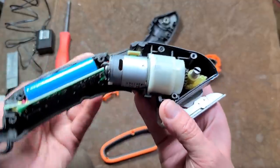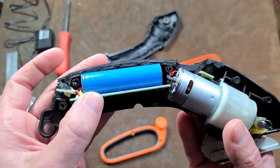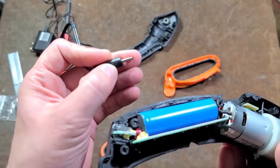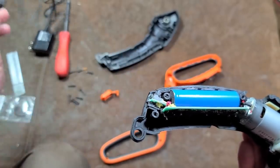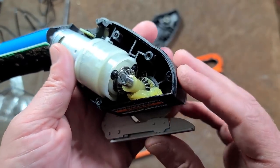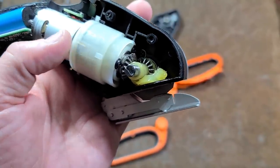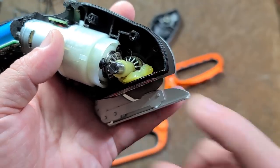It's just really cheesy. The molding is terrible. The battery is taped to the controller board as well — it's an integrated charge board. They use these super proprietary, super microscopic 16th-inch concentric circle power plugs. These are like the hardest style to find and they're microscopically thin. If this were ever to fall with it plugged in, that thing would snap off in a heartbeat. But they have this odd value added — probably in testing it just would not cut at all using bushings — not the bronze or copper-gold colored sliding bearings. So on the output gear, there's actually a ball bearing. It does indeed have a ball bearing on the spindle. It's not rubber sealed like the Skill.